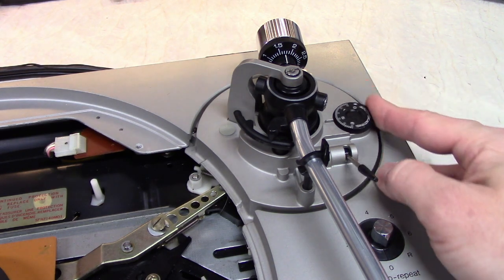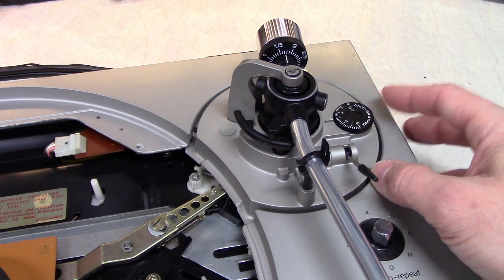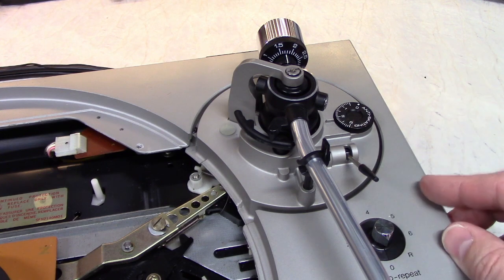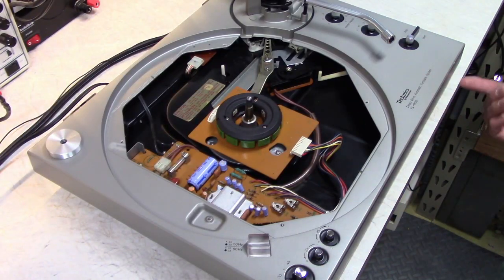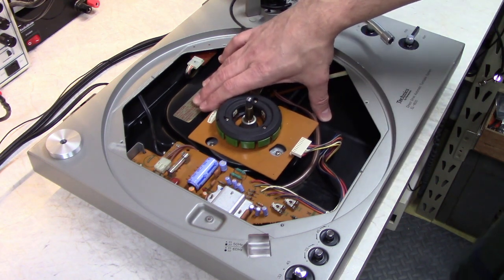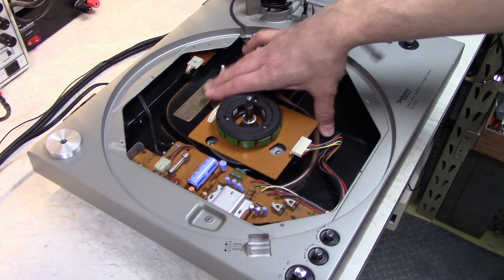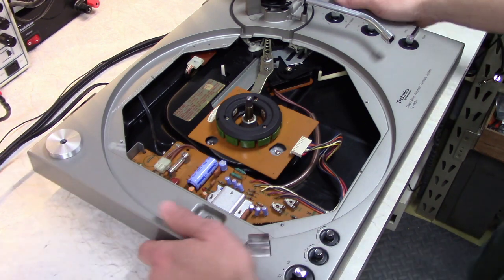This anti-skate wheel has a real dry, cheap feel normally, but a small amount of silicone grease on the axle really gives it a nice smooth feel — I did that to this one when I took it apart the first time. The way the suspension works on this turntable is the feet are attached to the top and the bottom plate actually floats on springs, and the tone arm follows it. Mine's making a weird squeaky noise because of the springs and the rubber. To lift this off we need to remove the four feet.